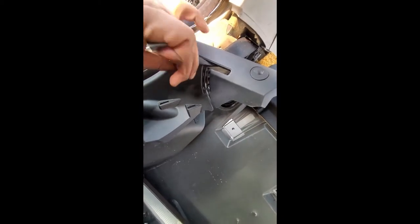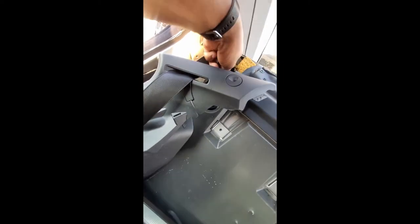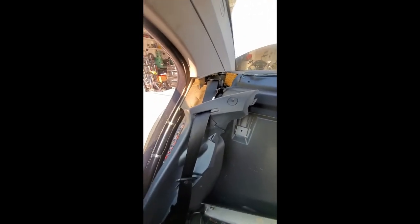These pieces here have a little tab that just pops out of the back so you can slide the seatbelt in. Once you get the seatbelt in, just snap this back in place — that just holds the seatbelt. There's a plug for this light on the other side which goes to these, so make sure you still have those visible when you do it. There are two plastic nuts that go here and here to tighten that side on. Once you get it on, you can put this bottom piece on, and then we're ready to put the seats in.